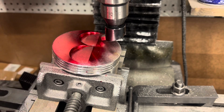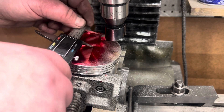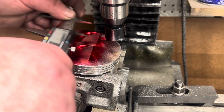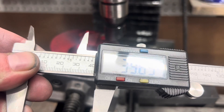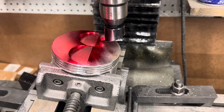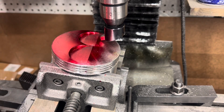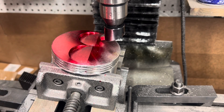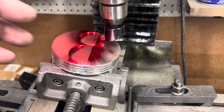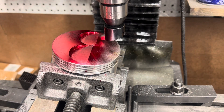The stock valve relief in this piston comes for like a 34-38. We're actually doing a 48-33, so we got to open them both up. I've already done the exhaust — I know it still looks factory, that's how nice this cutter is. We can come in here and grab a measurement on this exhaust and we're at just under 40. You want it to be a little bit bigger than the valve because you need side clearance since everything's moving around in there — about a millimeter all around, or sixty thousandths if you want to be a hundred percent sure.